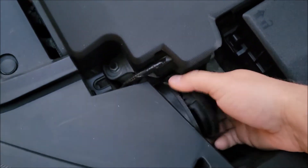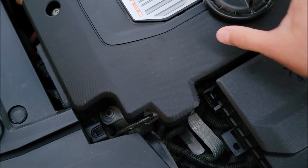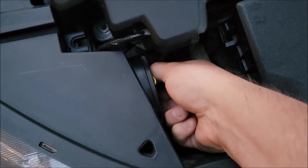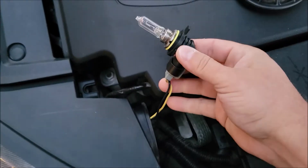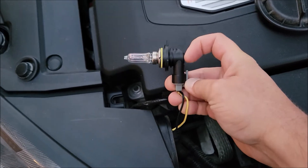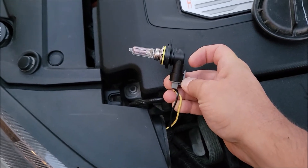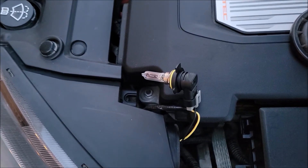The basic steps: you come over here and take this seal cap off, then if you put your hand in, you'll find the bulb. There's a little connector you have to turn and pull — that's the light. It's a pretty easy style: you undo this clamp, the bulb comes off, you plug the clamp into the new bulb, and put it back in.